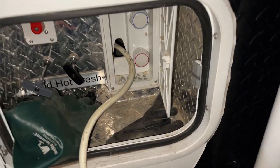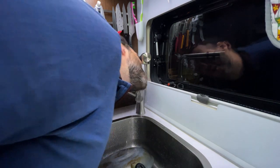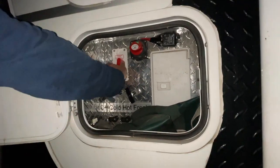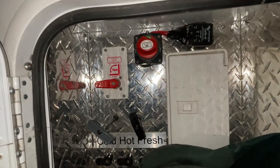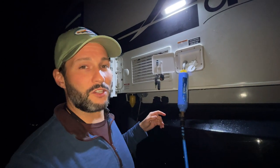It's about 9:30 and I'm trying to finish this up. The tank is full; I'm still running a little bit of water through it and I've opened up my low point drain for cold, then hot, and the fresh tank drain. I also run the outdoor shower briefly. Since I'm not drinking out of these connections I just want to run a little bit through to make sure I get the concentrated bleach out. The water tastes nice and fresh, so I'm going to remove the bypass for the hot water tank — now it's back to normal. Tonight when Sasha and I shower and do dishes I'm going to run off the tank, and when we leave tomorrow morning I'll refill the tank to complete the process.